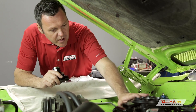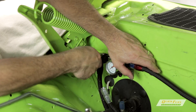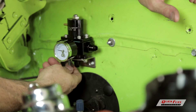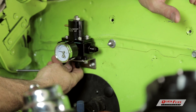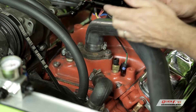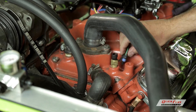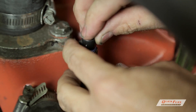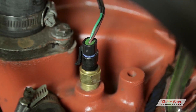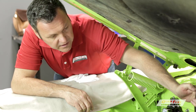When we're done mounting the throttle body, the next move is going to be swapping out the carbureted regulator, which is low pressure, for this high pressure EFI regulator that comes in the master kit. The computer requires a signal from the temperature sensor, so we removed the pipe plug that was in the port, replaced it with the sensor in the kit, tightened it, and connected it to the main harness.